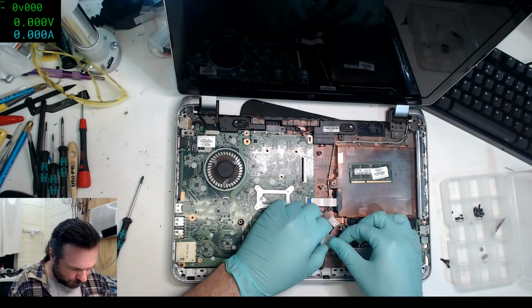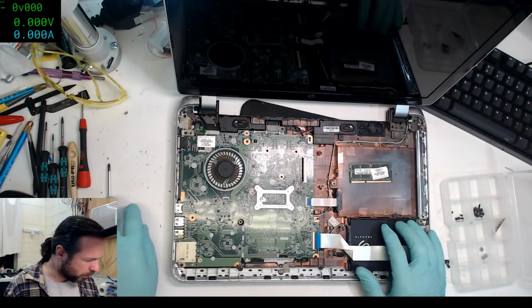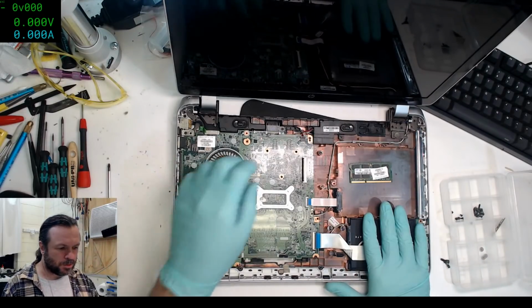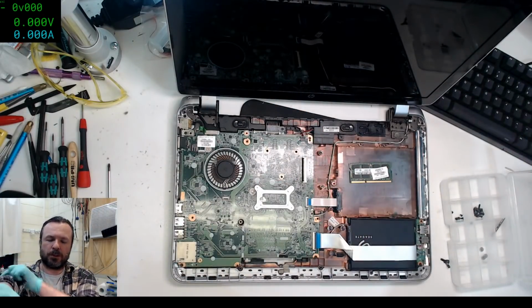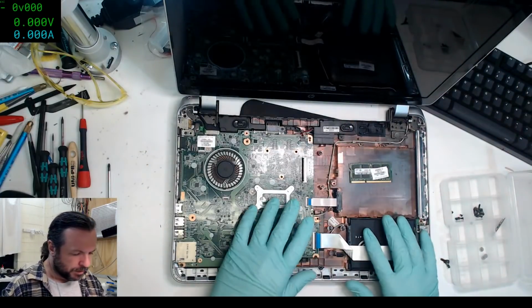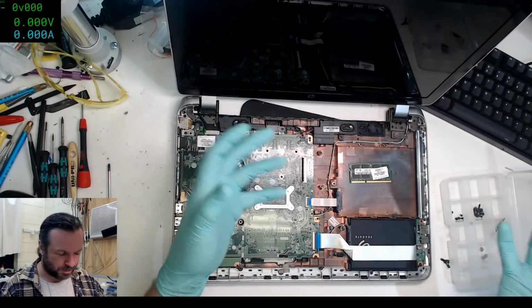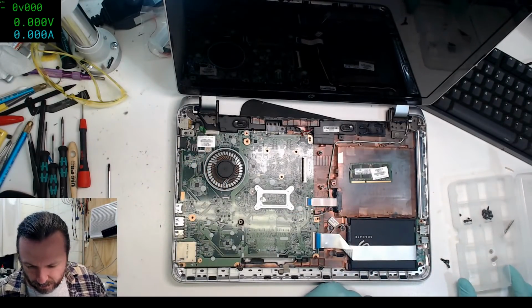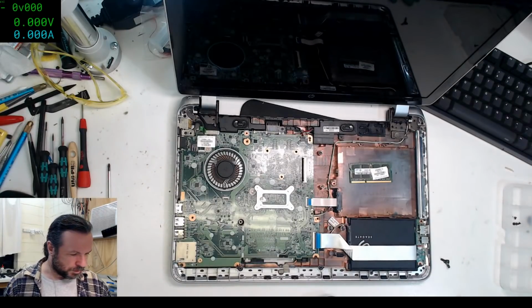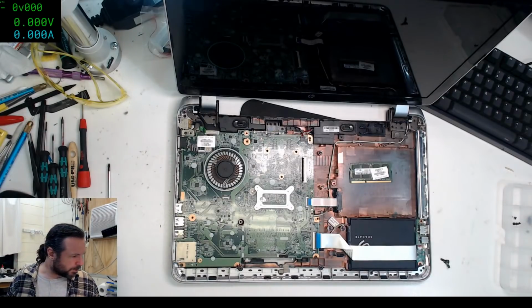This is going to be a little bit of fun, but not a lot, where I wasn't able to prep a lot of this drive because Windows is in one of those hibernated states, so you can't shift the partitions around or expand or shrink them much while it's in the suspended state. So you have to transfer it to the drive, and then boot from the drive, and do your shutdowns and turn off that stupid fast shutdown that Windows has. And then you can actually do the cleanup and expansion of the partitions that you want to do. It's a tad frustrating.